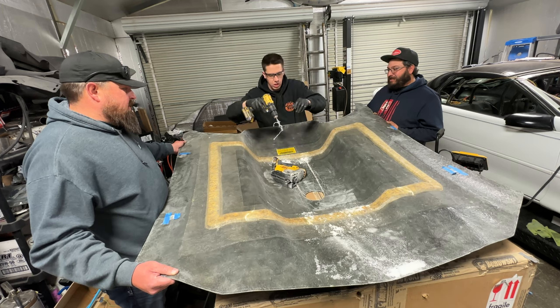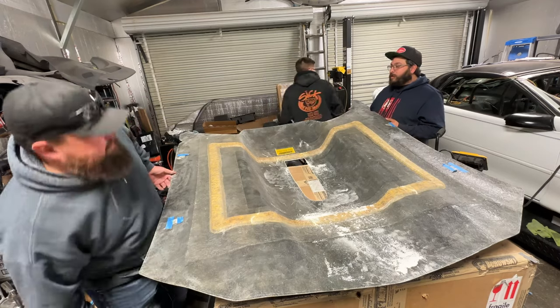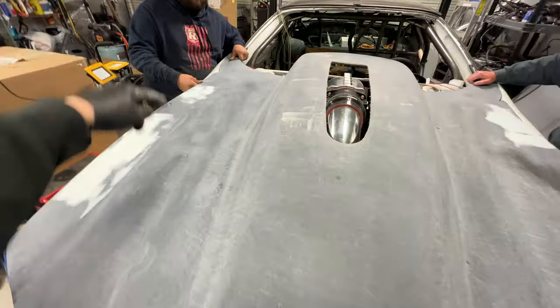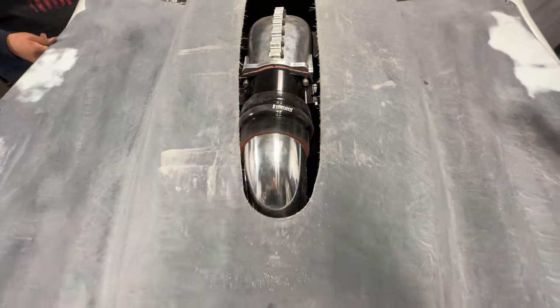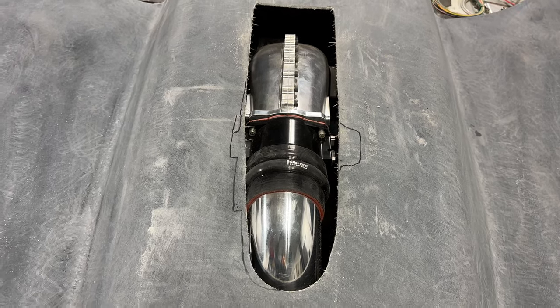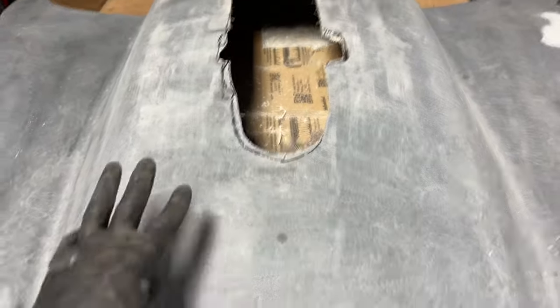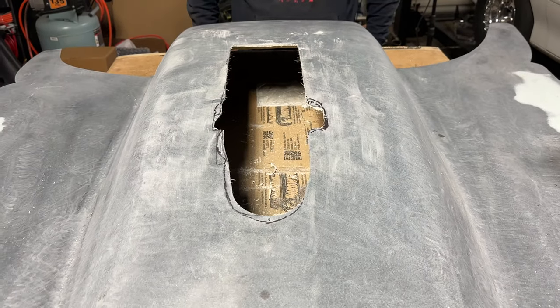That worked. I think it's a little thicker in that area too. Probably not even close — as long as we're too small. Coming almost through the hole, just trying to line it up. The little notch on the fenders. Now you can see I can start working my way around the throttle cable spot. I need to open up a little on this side and then the TPS and all that. We're going to open up a little bit more and then refit it. I'm going to try this one little step at a time because I don't want to be overly too big. We know the hood needs to shift this way a little bit, but we're rubbing here — once I clearance this it should let it shift. Almost there. Not quite. Round number three — need to come a little here, a little there, just a little for the throttle. Getting there, just a little bit by a little bit.